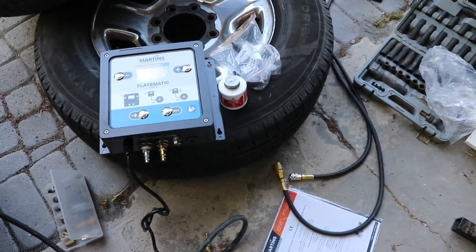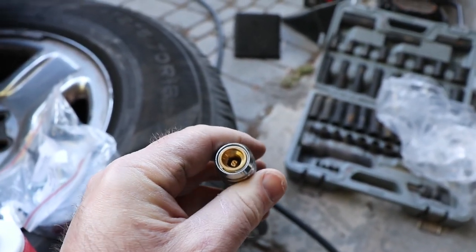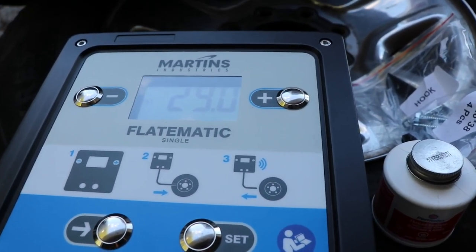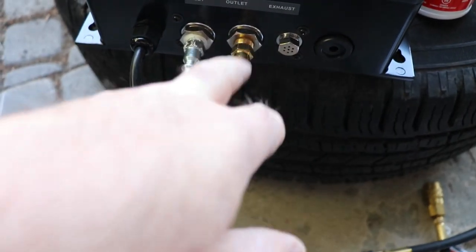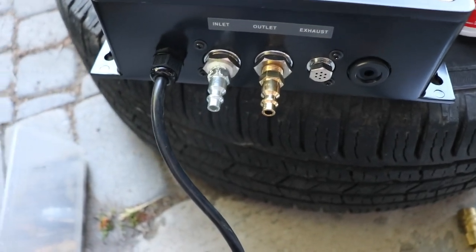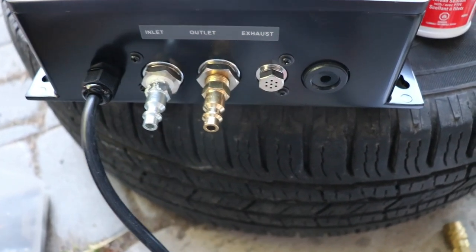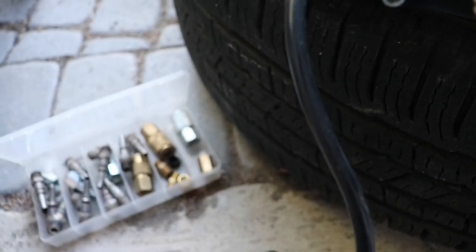With the single hose you need a flow-through head, so it's just going to be pumping out air — kind of like the coin-op gas station air fillers, they act like that too, they just blow right through. You set the pressure on the unit and it'll pump up your tire if it needs it and deflate it if it needs it. When I got it, it had the fitting for the air line to the tire but no fitting for the shop air. Luckily it's just a regular kind of fitting — it's not meant for a three-quarter inch big rubber hose or anything like that.